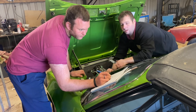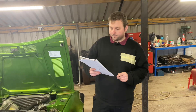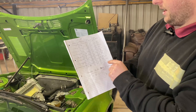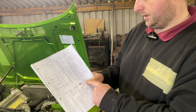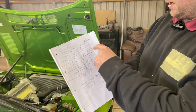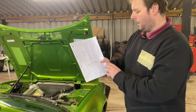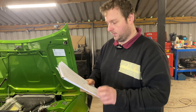We're reading 17.45 — same as the first. We've now finished measuring up all the valve clearances. Here's what we've got: the clearance as it is at the moment, the thickness of the shim that's already in there, and we've added those two together, minus our required clearance of 0.2 mm — for you old-school people out there, that's 8 thou. We've come up with what the shims need to be for each valve on each cylinder, and we'll get those made. That should get our clearances absolutely perfect.